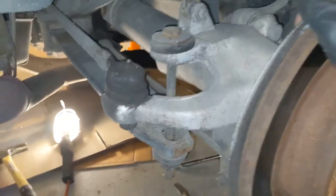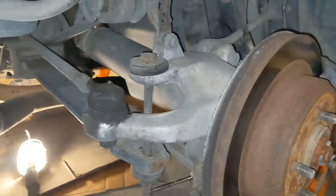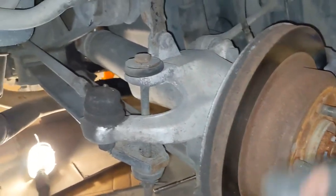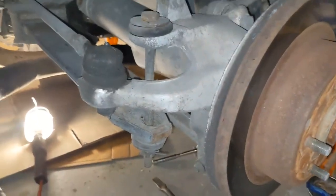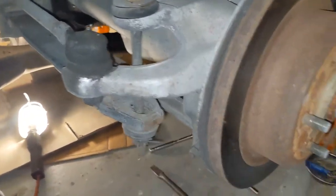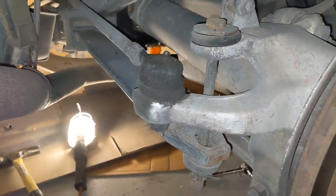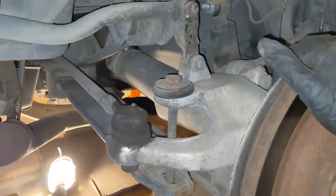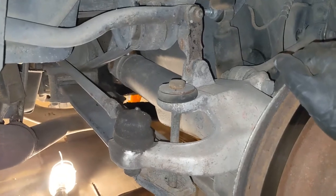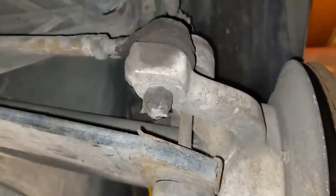In order to get enough clearance to get the CV shaft out, the shop manual says to basically tear the whole bottom end apart. I've seen some videos where someone takes the leaf spring out, and others where they've just done the tie rod. I did the tie rod method on the other side, tried to get the half shaft out with the tie rod on - and apparently you can't. So I'm going to take the tie rod off now.